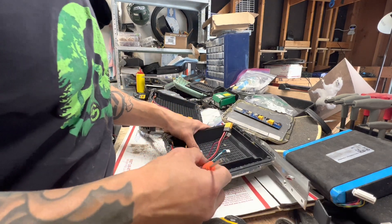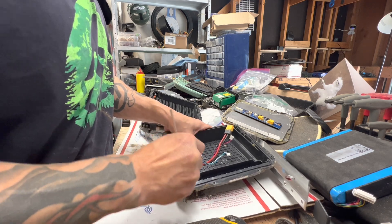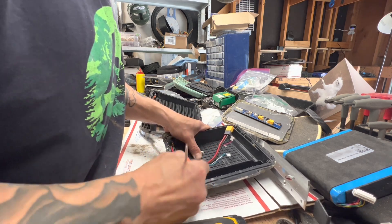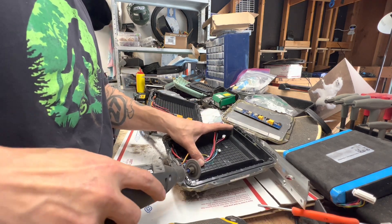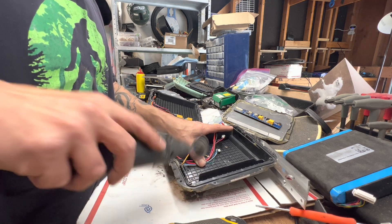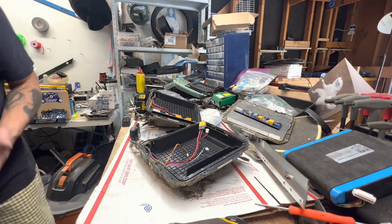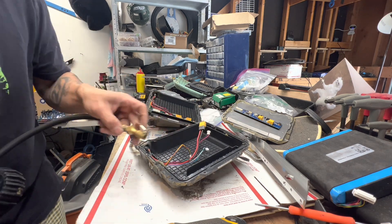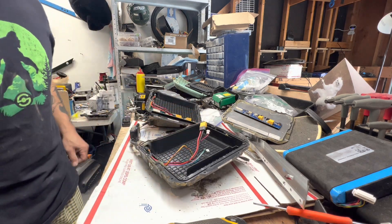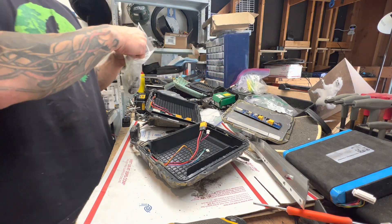I should be wearing safety glasses. I have that little poker tool there to just help start to deburr all of those little areas and make sure none of that melted plastic is sharp and can stick into a battery or into a battery lead, because the last thing I want to do is make more problems trying to fix a problem. After that's all well and good, I'm going to blow it out with a compressor — you want to make sure you do that because you don't want little pieces of plastic in there. You've got to check for some afterwards.